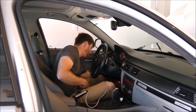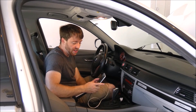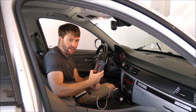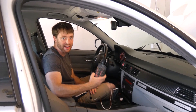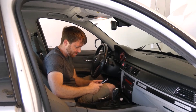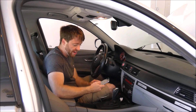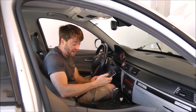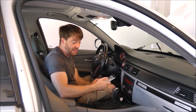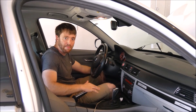To verify it worked, plug back into your car, close out MHD completely, and then reopen it — it doesn't work correctly if you skip that step. Then go to Flash MHD Map again, same process as before, find the map you're running, but don't write a map this time. Navigate to the options and it should now say 'Sport' for the coolant target. We're confirmed in Sport mode.